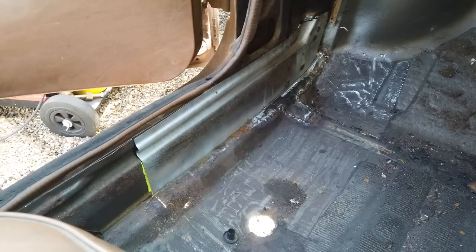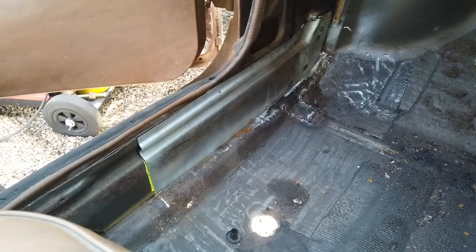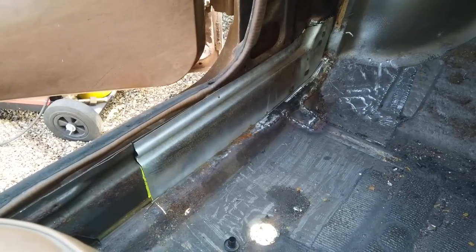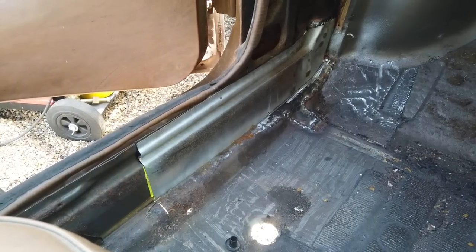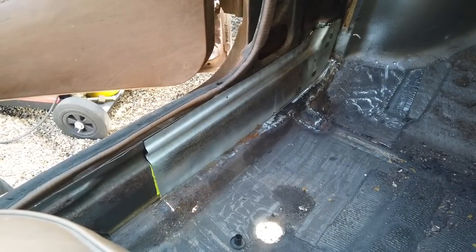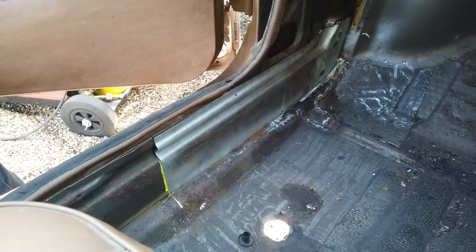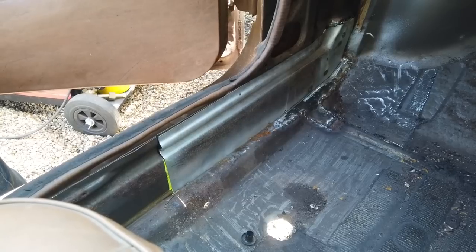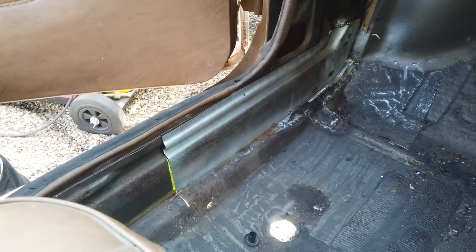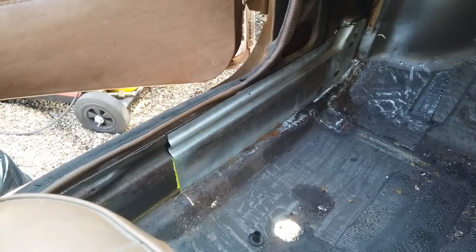And I felt awful. Really, really tired and run down. Almost like the chemicals are in your bloodstream. I might be exaggerating that, but that's how I felt anyway. I still enjoy it, don't get me wrong. I just think I'd have to be doing this outside. Now, welding inside the workshop on a non-dipped shell is difficult. It's not as bad on a dipped shell because you don't get the same combination of chemicals burning. You only get the metal itself because it's totally clean. So that's manageable, though even with the door open it's still too much.